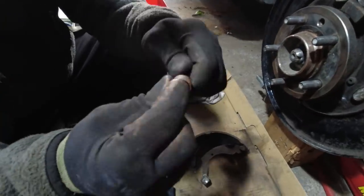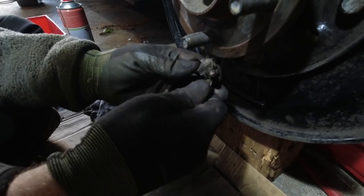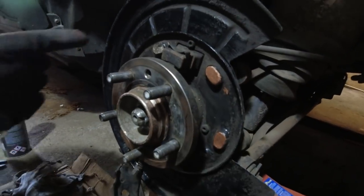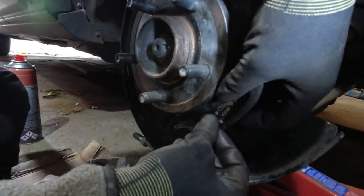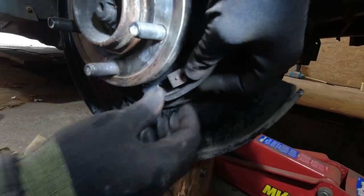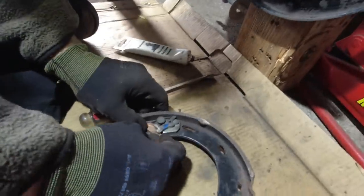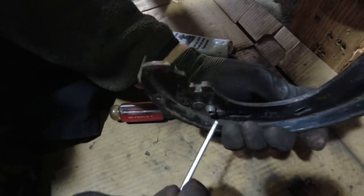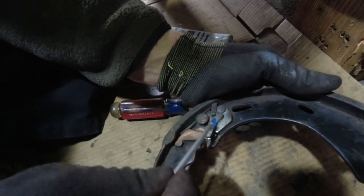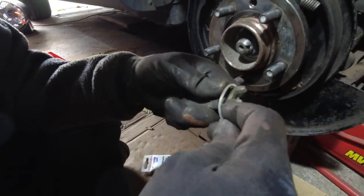The spring over the parking brake cable goes on like this, sitting in this little notch here. Brake shoes on. Coat all contact points with anti-seize or high-temperature grease. Put the clip on with the closed end towards the adjuster wheel, which will be down here. Put a light coat of anti-seize on the adjuster wedge and put it back in position. Tighten it. Then put a tie wrap around here so the spring stays back — don't want to forget to cut that tie wrap off later on.